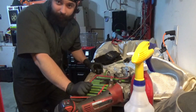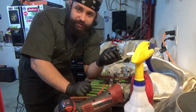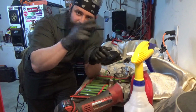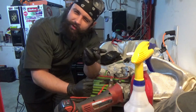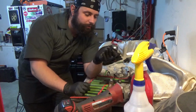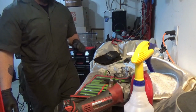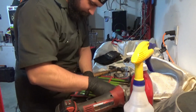Okay, that, but I didn't, so oops. What I did was I got a set of vice grips, just grabbed the top of the ball joint, took an angle grinder, cut around the top, so then it was just this cup. I also took out the snap ring with a set of snap ring pliers and punches, as I may have filmed, I don't know. Anyway, once you cut this off, once you take the ring out, you can just whap it with a hammer, pops right out, super easy. Which is what you need to do whenever you do the uniball conversion for upper control arms, which you should do if you have a 4Runner.